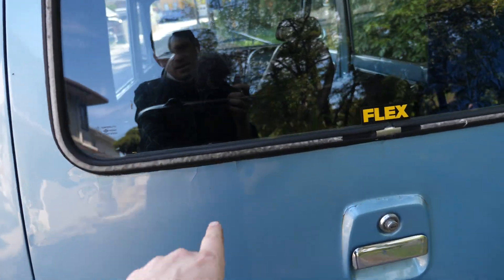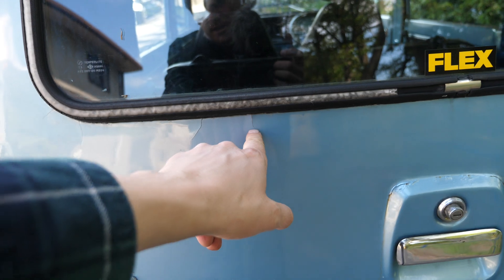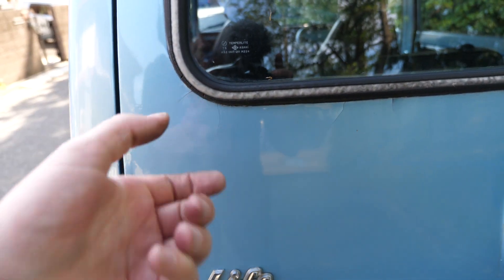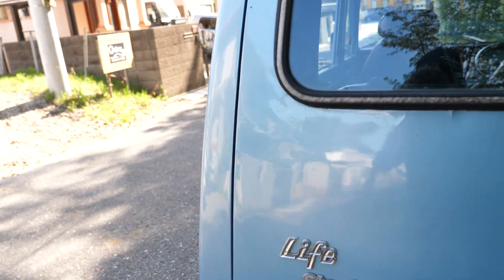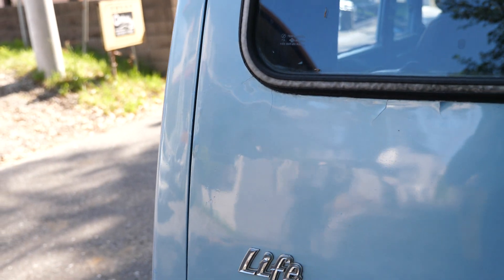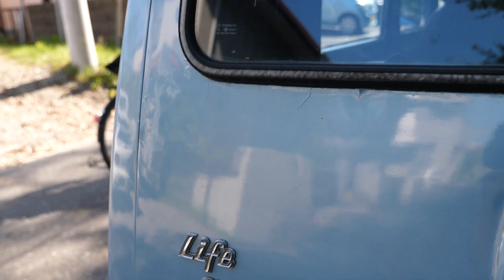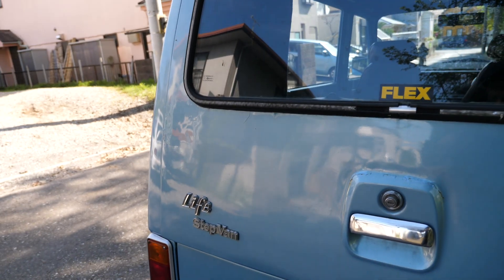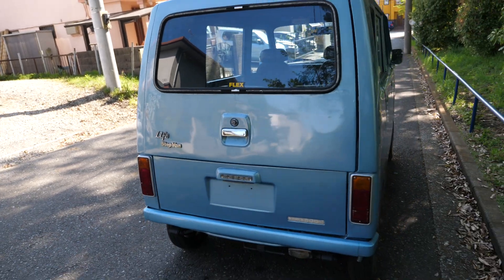Here's a good example — see the cracks here? There are cracks in the body filler and some rust underneath. When a car has been fixed with body filler, it gives it this kind of wavy, non-metallic look. And the car has that on pretty much all of the panels.